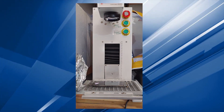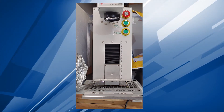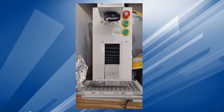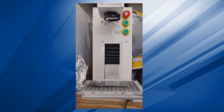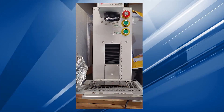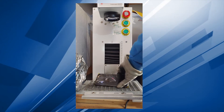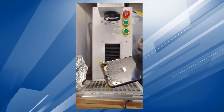The laser is slowly but surely pulverizing the adhesives. The template for the iPhone XS can be encoded on the machine so that it will skip over the camera and the charging pad for wireless charging. And right here, it's done. David will remove the glass with proper protection and proper protocol.